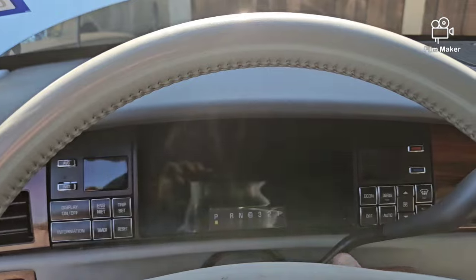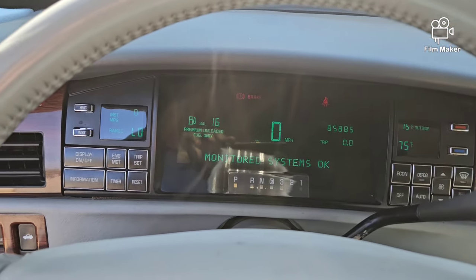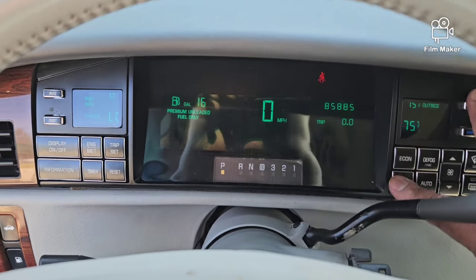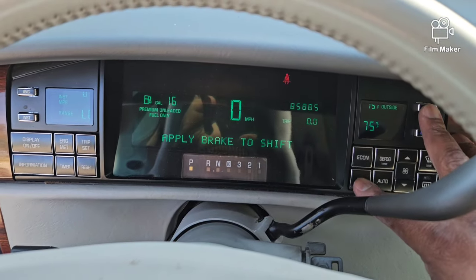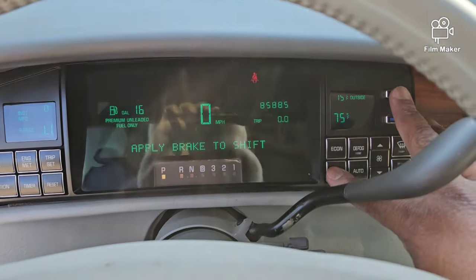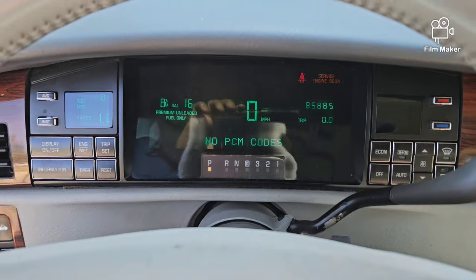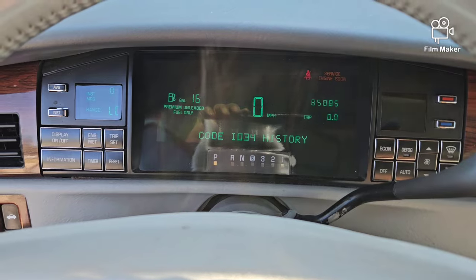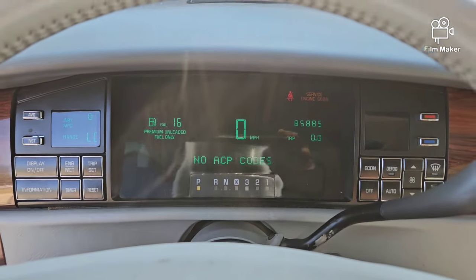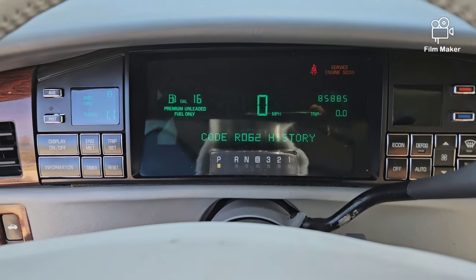So I'm getting into the car. We're going to turn the key on — make sure we don't have any music playing because I don't want any copyright violations. So to get into the diagnostic screen on these 80s and early 90s Cadillacs: you're going to push the Off and Warmer buttons at the same time and hold them down, and then it's going to enter diagnostics.